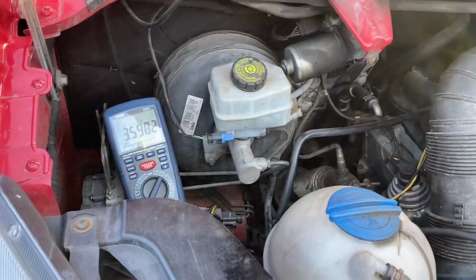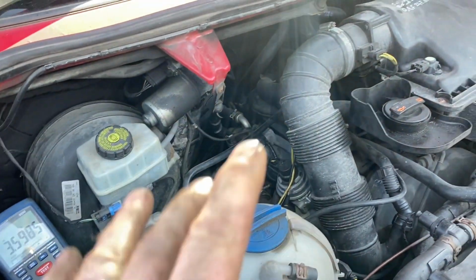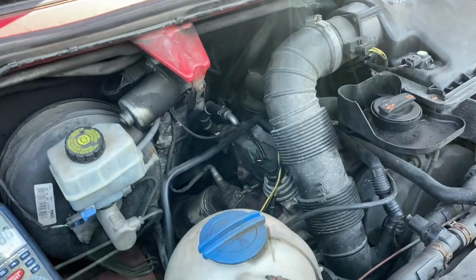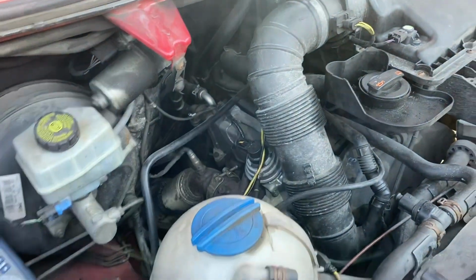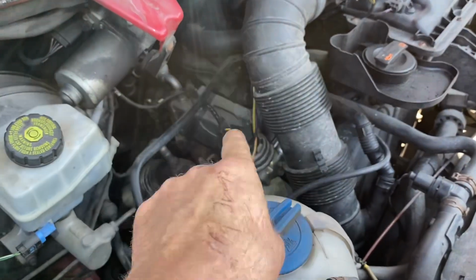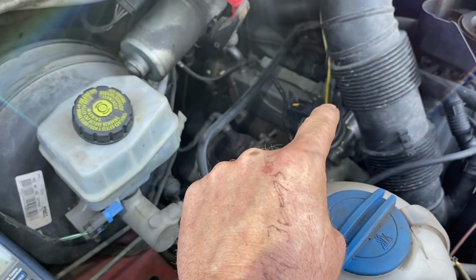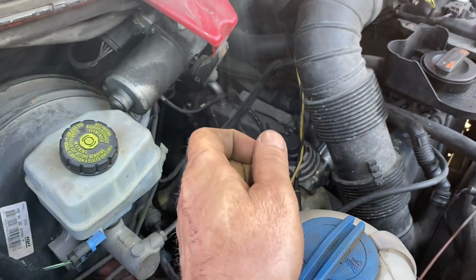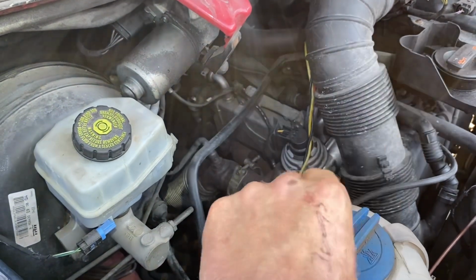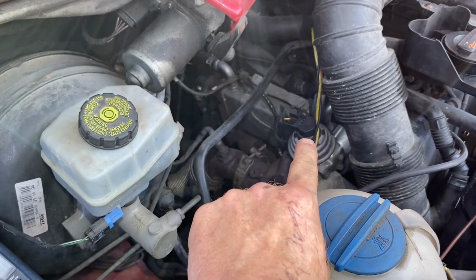So what are we hunting down now? I have seen, Mechanic Matt, and I have gotten caught myself with EGR coolers and stuff like that, but yet it's giving out about the position of that rather than underboost or any kind of an airflow fault. So here's actually an interesting one. That's the position, okay? If I disconnect the block connector on the signal wire, that 0.75 of a volt is coming out from that position sensor here.